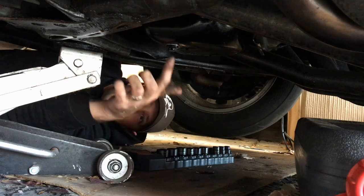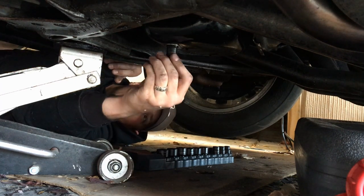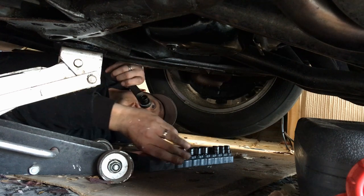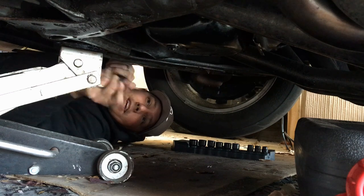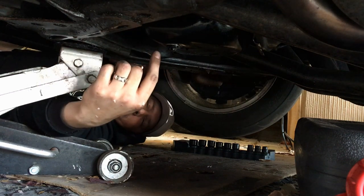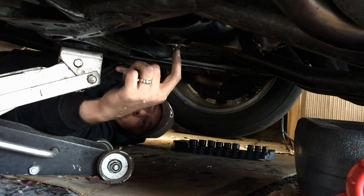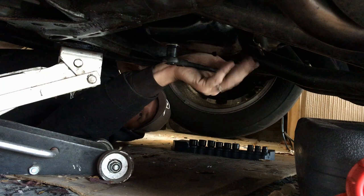On a Fox body you've got one up front and one in the back on a dual sump. I'm going to show you a little something that I found that fixed my issue and was very cheap. Russell makes a pretty slick little nylon — it's basically a rubber-impregnated washer — and that goes between your drain plug and your oil pan, and that will fix your issue.